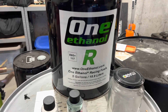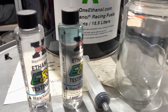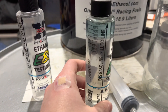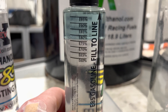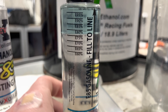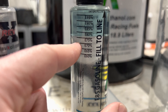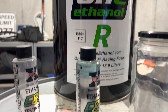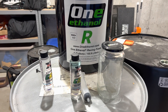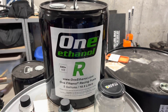For those of you that don't know, normal E85 is roughly 105 octane. This is what I was using at ModNats. You can see it's about E76, E77. So obviously anything over E70, that mark is good - you'll be good to go. It wasn't just E75 roughly at ModNats, and this is what we're using now. ModNats was just E75.